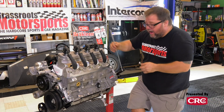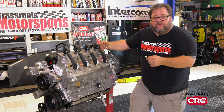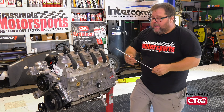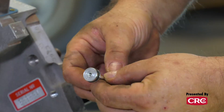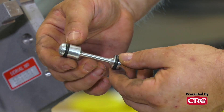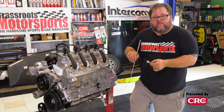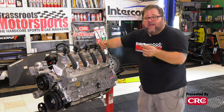So this is actually an important part of the engine. Any LS third gen engine is going to have one of these from the factory. The factory ones are plastic with nitrile o-rings — they're perfectly acceptable. This one is from Improved Racing. It's a little bit nicer, machined out of 6061 aluminum. It has nice radius corners that allow the oil to very smoothly flow through that passage, and a nice radius dome where the oil first hits it as it comes through the passageway. It just smooths everything out, and this is essentially a reliability upgrade.